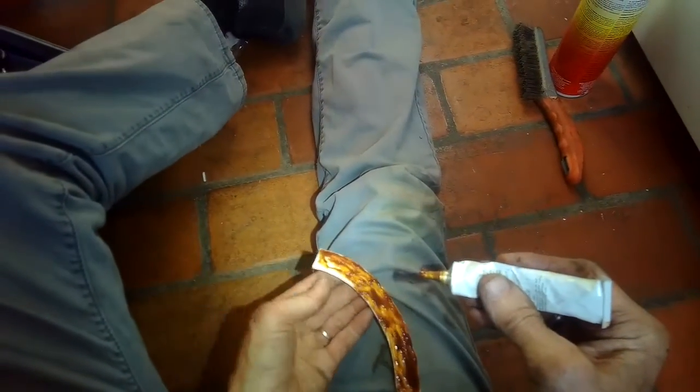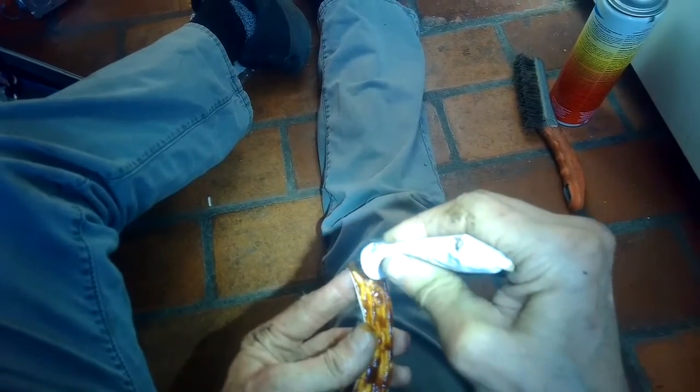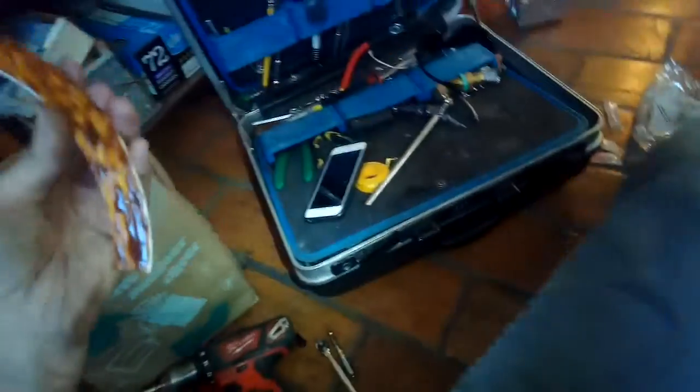And then once you get everything done, all 3 pads glued in, it'd be great if you could wait about 15 minutes before you let the tub assembly rest down on it again. So I'm pushing down with my fingers to get that second one on there really tight. The damper pad with the lubricant just allows for a really good bearing surface, and then the tub can move around readily on that surface, and that helps it to spin really well. If it binds though, then the spin gets really crazy and it bangs around a lot. So here's the third pad.